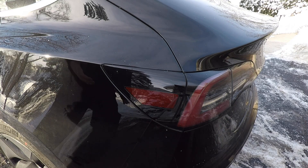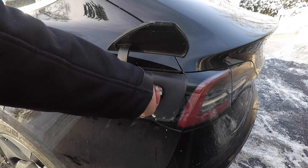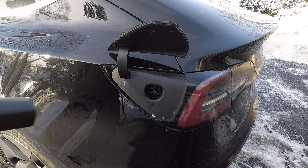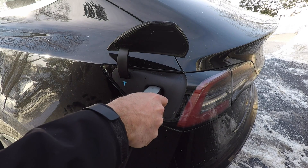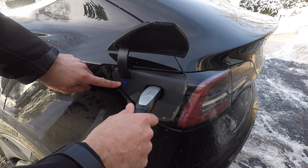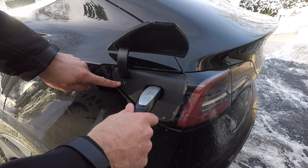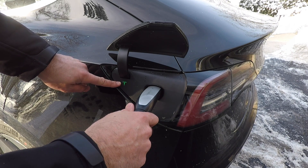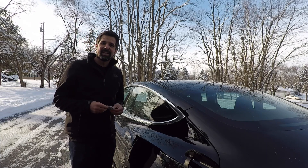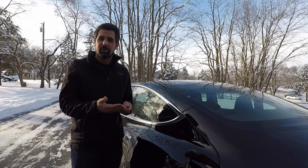It's been about 8 minutes since we put the hand warmer in the charge port. We're going to fire this thing back open and pull it out — oh yeah, this is nice and warm. That feels great. Getting our charger — we got the light blue. We are up and running! We got the green flashing Tesla logo, which means we are charging and ready to go. It turns out a hand warmer for 8 minutes was enough to thaw the charge port latch and get us back up and running. Something as small as a hand warmer actually does have a pretty good effect on thawing your charge port latch.